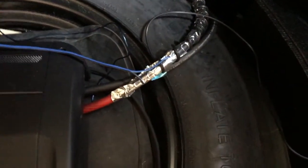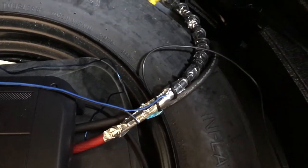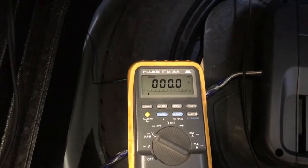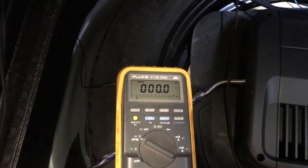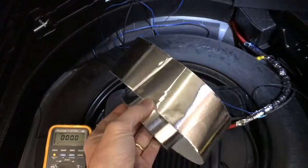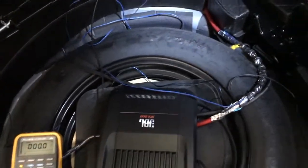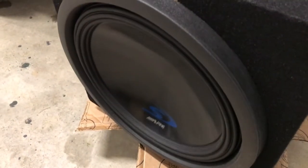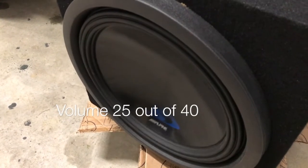What that wire should do is, as that magnetic field builds and collapses, it should be absorbed and grounded directly to the chassis. I can even see in my meter here — it's all zeros, where before I had a reading every time I touched the car or made a movement. This foil tape I used is just duct wrap tape you can buy at Home Depot — it does conduct electricity, I checked. Let's try the test again at the same level as before. And you can see — nothing. And like before, there it is, it's playing. I have it on volume 25 out of 40.